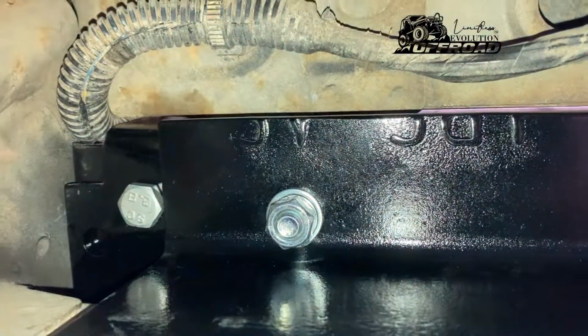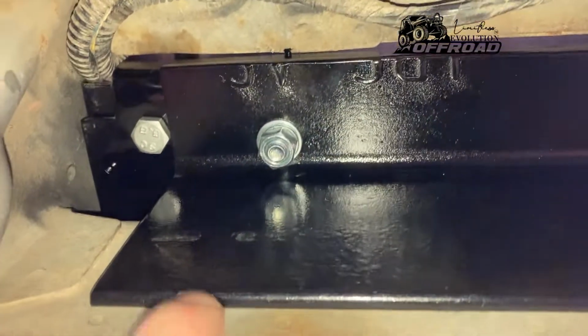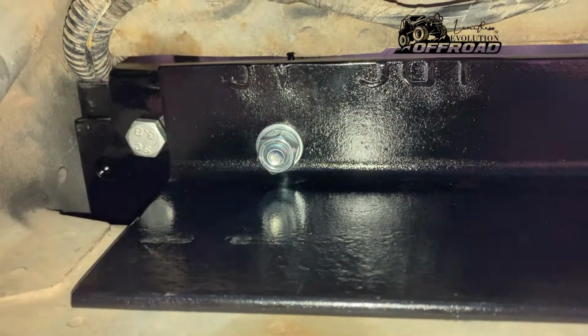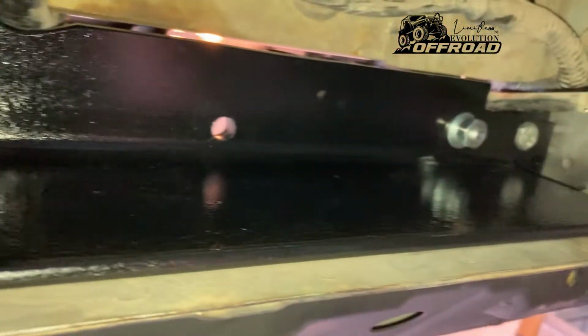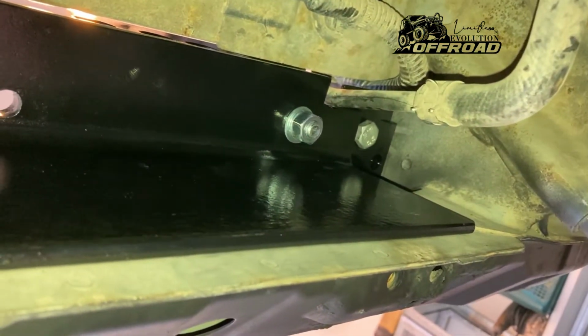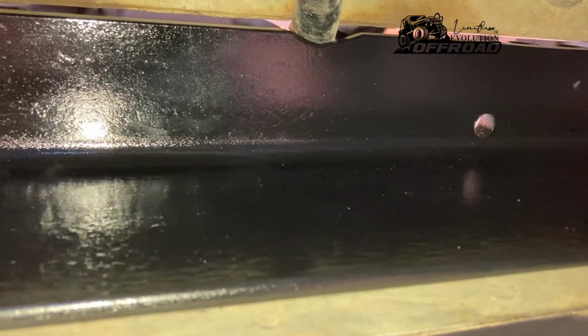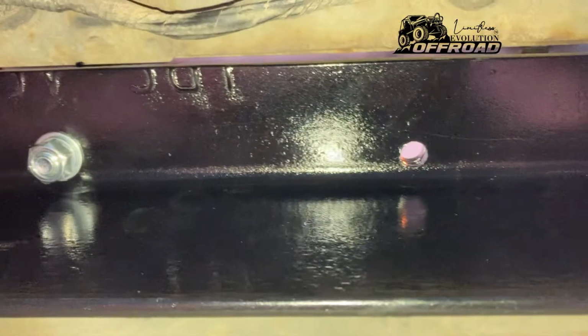and through there, and pretty much the plate comes pretty far down, just not visible, and it's the width of the winch plate on top there. So that's about 60 mil on top and then 100 mil underneath. So that plate over there will stop the winch moving forward and stop the winch plate actually buckling towards the top or warping. So yeah, that's as far as we got so far.